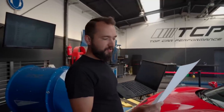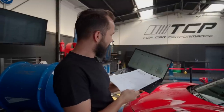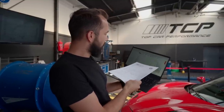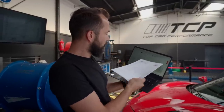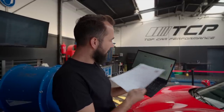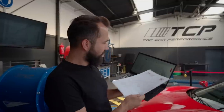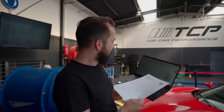So we're actually missing about 40 PS — but clearly it's very warm today, nearly 30 degrees. Looking at the logs, I can see no ignition retard at all. We're running 16 degrees of ignition timing at redline. The car has a constant boost pressure of 1 bar all the way to redline — we'll raise that a bit. On the ignition side we'll target 20–21 degrees afterwards, because with ignition alone we can easily gain 40 PS.